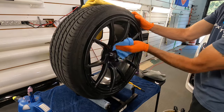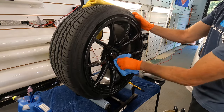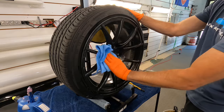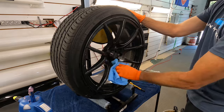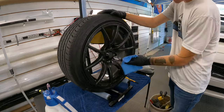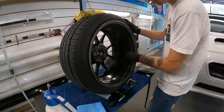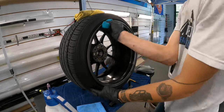Tip number eight: when wiping off a coating of any kind, use a short-nap towel — that cuts down on fibers getting stuck in the coating. By the way, you get enough coating in the bottle to also coat your calipers and any finished surfaces in the wheel well area. Apply the coating to the face of the wheel and immediately start to wipe off, then flip the wheel over and do the barrel and the back of the spokes.